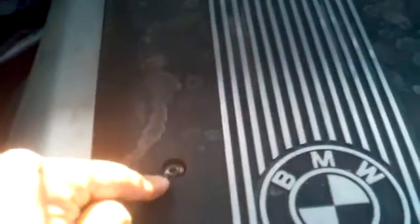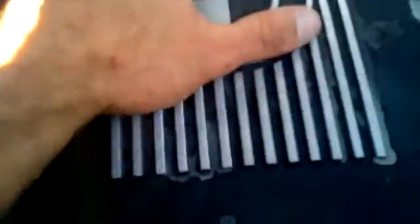Mass airflow sensor and secondary air pumps are down here, and obviously the air box is pretty easy to install — just pop these clips off if you want to replace your engine air filter. There's your washer reservoir. If you want to take off your vanity cover, some have just a push clip, but this one actually uses a 5mm Allen — do a 90-degree turn, give it a twist, it unlocks and you can take that cover off. That accesses the intake manifold which is under here. If you want to take the covers off on the sides, there are little squares to access two 10mm screws that hold the panel down, which gives you access to the ignition coils and spark plugs.